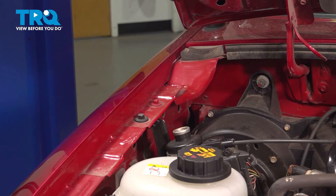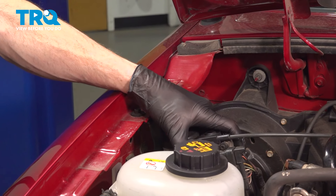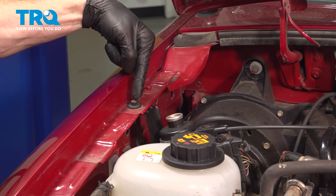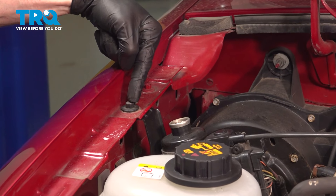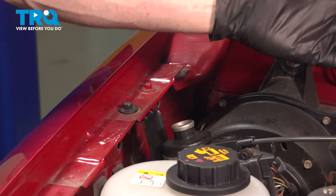Okay friend, let's get started on our job. Along the passenger side under the hood, you're going to find your cruise control unit. We'll dislodge that by removing our one 10-millimeter-headed mounting bolt holding it in place. Once you've done that, continue on by swinging it aside.